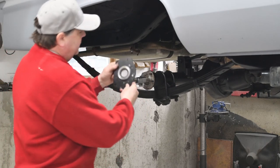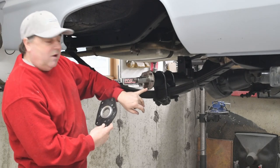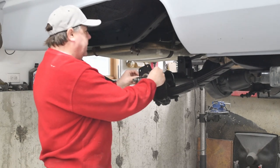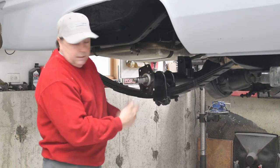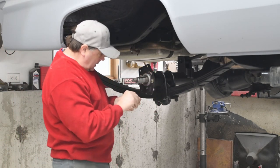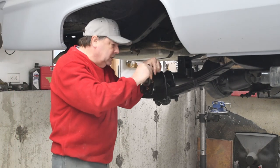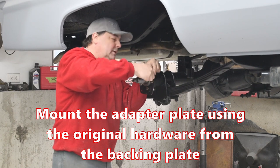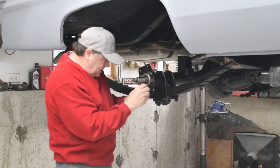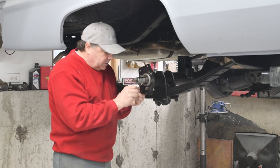The adapter piece is kind of triangle shaped. You'll notice there's a flat spot here — two bolts in the front, two bolts in the rear, and one at the bottom at about 5 or 6 o'clock. Just slide this right onto the shaft, right over those bolts, and voila, the adapter bracket is on. I've got some nice fresh new lock washers. I'm going to put those on, and then put the nuts on — these are the original nuts that held the backing plate on. I didn't see any real reason to change them; the hardware looks okay. I just replaced the lock washers to make sure they weren't flattened out and would hold this so it wouldn't loosen up.